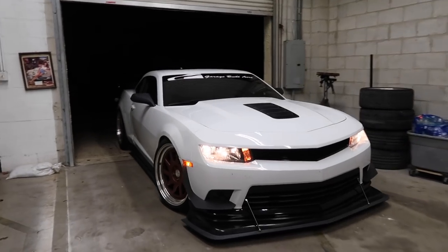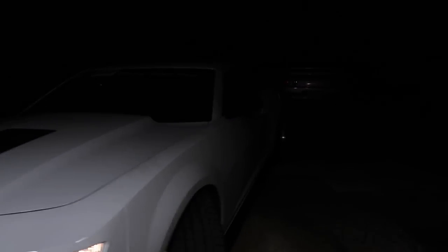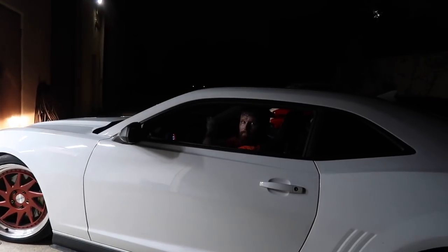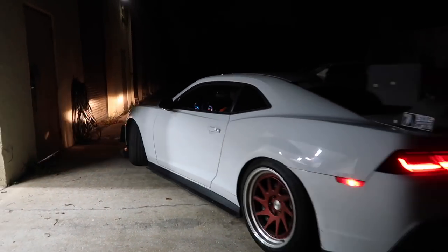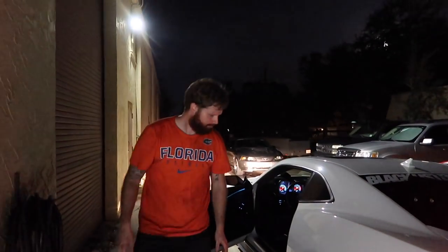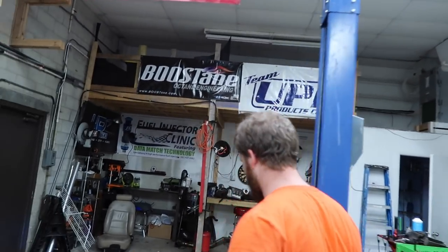She's done — not too bad, Mantic clutch install complete. For break-in: 500 miles if you're doing city driving, about a thousand miles if you're mixing highway and city. Thanks to Jeff from Mantic.